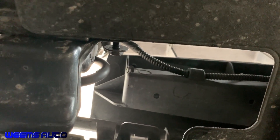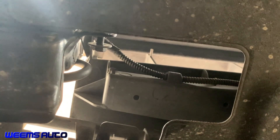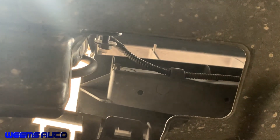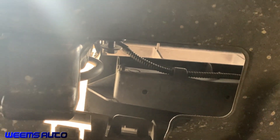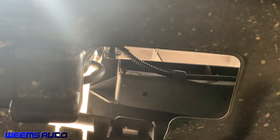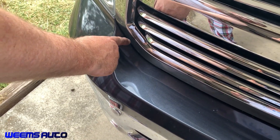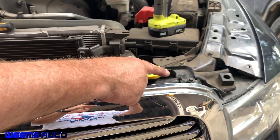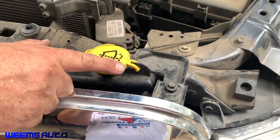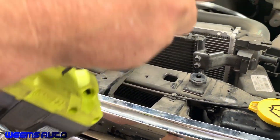Here's the bolt at the bottom of the washer fluid tank — it's a 10 millimeter bolt, accessible underneath the truck. I'm going to get that one zipped in and then the other one, and we'll get the grill popped back in. At the bottom of the grill we have two clips that need to get popped in, and at the top we have four bolts, all 10 millimeter. The long screw-type ones go on the outside; the more finely threaded ones go on the inside.